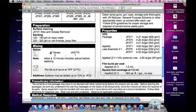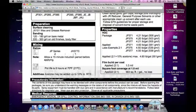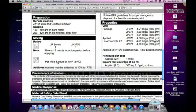Mixing ratios on this: two parts primer, one part 3770, so you know exactly what the ratio is. With epoxies, usually you don't have this, but right here it says allow a 15-minute induction period before applying — this is very important. If you don't let that set, it's not going to mix properly and you could have a lot of problems. We've talked about pot life — how long can this sit in the cup usably — and epoxy has a really long pot life. This has an eight-hour pot life, which is really good.